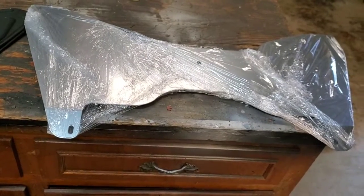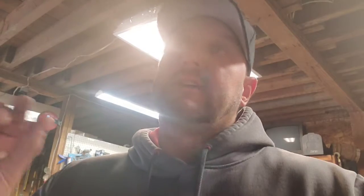As you can see it's gonna be a lot more solid. I'm gonna get this unwrapped, get it mounted up underneath the car, and I'll get you some shots from there. All right guys, so we got it installed. I'll crawl under there and show you here real quick. I found they have it notched out on the mounting points — what I did was I used the center one, just went finger tight with it so that way I could adjust it back and forth how I needed before tightening everything up. Super simple, super easy. Like I said, this isn't a performance mod or anything like that — it's just an extra layer of protection if you will, peace of mind. It's a lot more sturdy than the stock plastic one, and it adds a little bit of aesthetic to your vehicle as well.